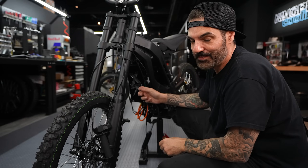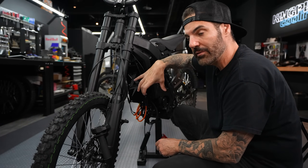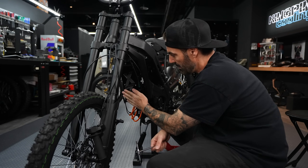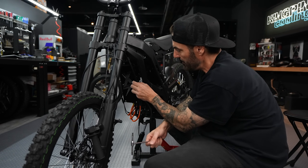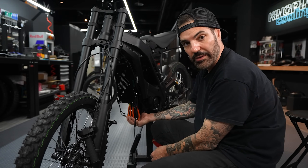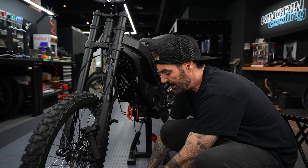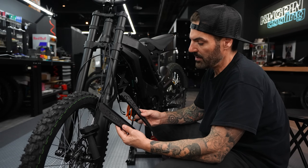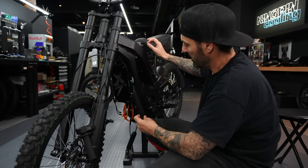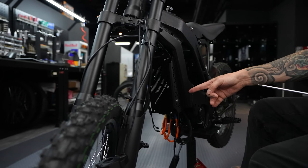You'll have some difficulty getting the controller on — you really have to sort all the wires out behind here to make sure it can lay flat. I struggled with it for a little while but finally got all the bolts lined up. Once the controller is mounted, route the brake line and throttle over here with the clip, tuck up all the wires, and put the new bash guard on that came with the kit. Mount the Bluetooth dongle underneath, and then these nice side plates that came with the kit go on the sides to tuck up the wires and make it look super nice.